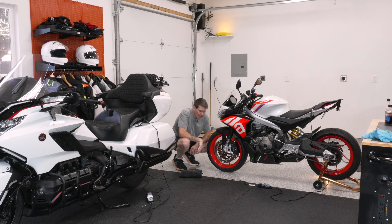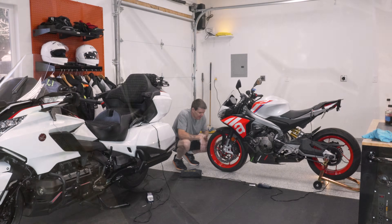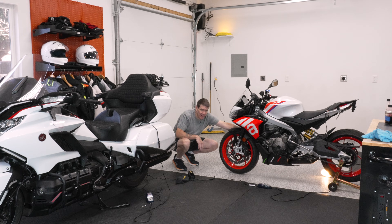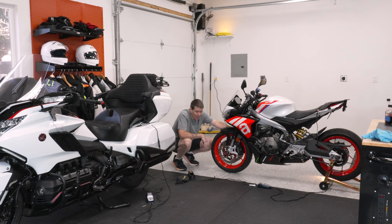Motorcycle tires are made of a soft rubber compound. They're also shaped very differently from a car tire — they have a narrow center. That center part sits on the ground, and over a long winter, that center part can get flat on you. So you don't want to just leave your bike sitting. You're going to want to get yourself a little portable compressor like this — I got this off Amazon, they're very cheap. I actually have a big compressor and I hardly ever use it since I bought this. Make sure your bike is at the right tire pressure, and all you've got to do is move it during the winter. Push it back and forth every couple of weeks — I like to do it every week or so to make sure the tires don't get a flat spot. It's pretty cheap insurance.